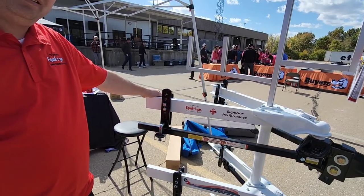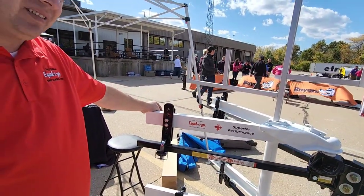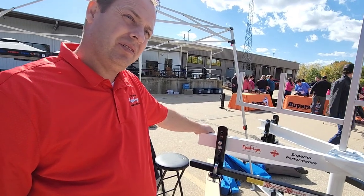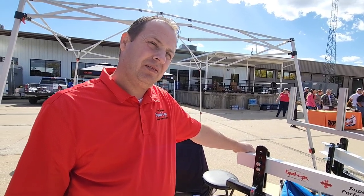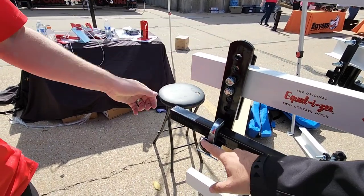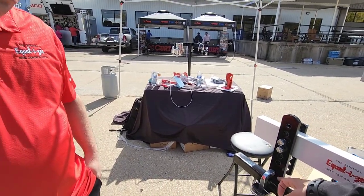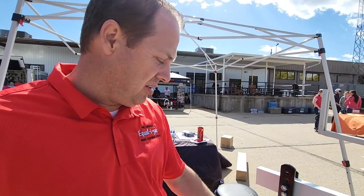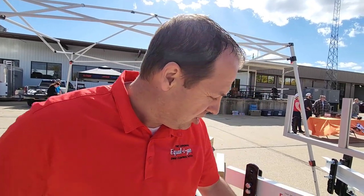It just wasn't set up properly. A point I usually make is that with a system like this and almost any weight distribution setup, you really have to set them up near perfect — there's not a lot of wiggle room. These bars have to sit perfectly flat on these L brackets to give you the friction you're looking for. Not completely flat across the entire bar — that's the ideal — but if you're hitting the front edge, it's still going to give some sway control. Are they getting the most out of the hitch? No. You do want that parallel bar going with the frame, laying flat on the L bracket — that's the ideal situation.